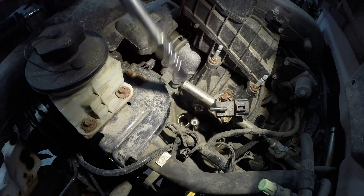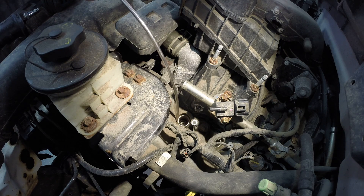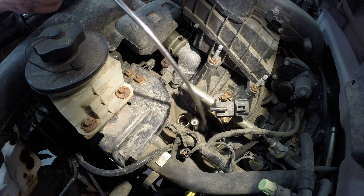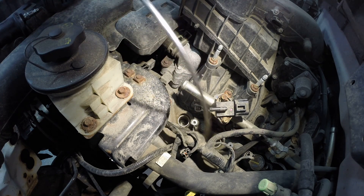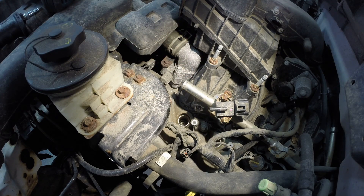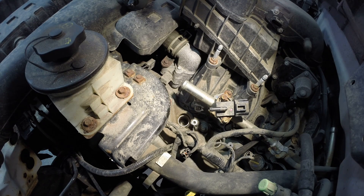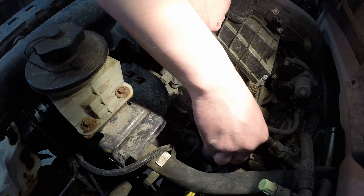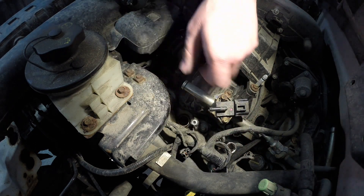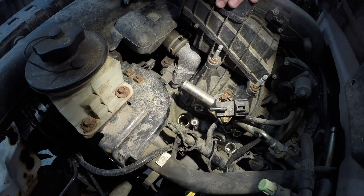At this point you can go ahead and torque these down. What I'm going to do is leave this plug screwed in tight by hand, start doing the other cylinders while they're hot, and torque the whole bank together all at once. I'll put links below to the latest spark plugs and everything I used here — the stubby impact, the anti-seize — so you guys have a reference.